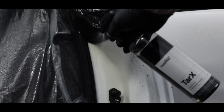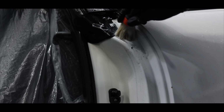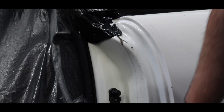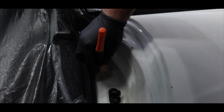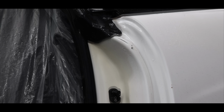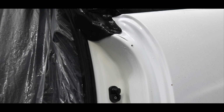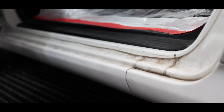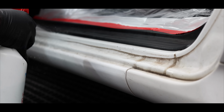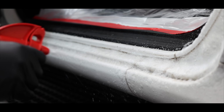Fifthly, it's important to note that sometimes an alkaline cleaner with a good detailing brush will remove all the bonded grime. But I've found that when it doesn't, using that alkaline cleaner prior to a tar remover helps the tar remover be more effective to remove that final layer of strong staining, so in other words they complement or help each other out. So I hope these points help explain all the whats, hows and whys, and gives you guys a few options to adapt this method to better suit your own needs.